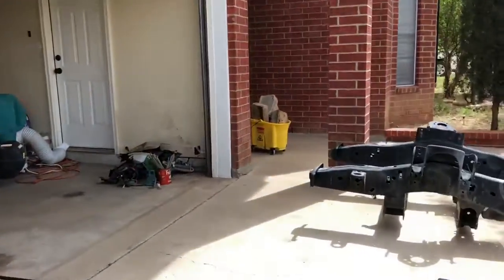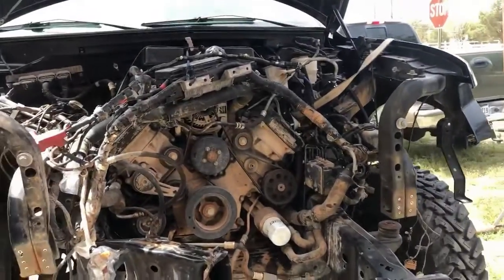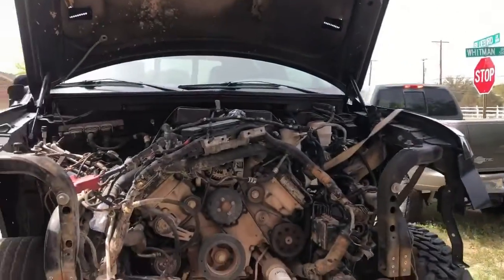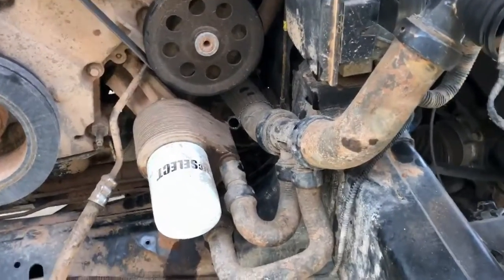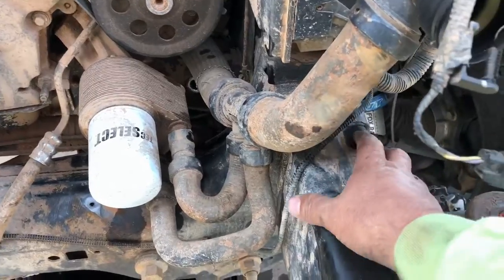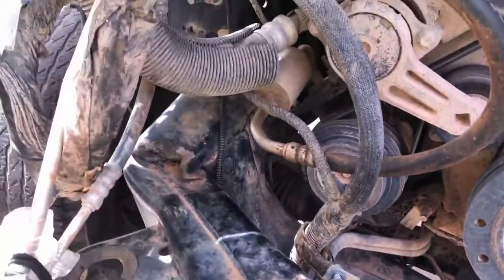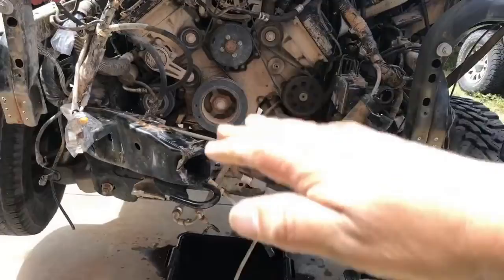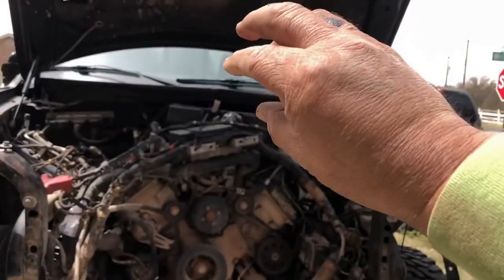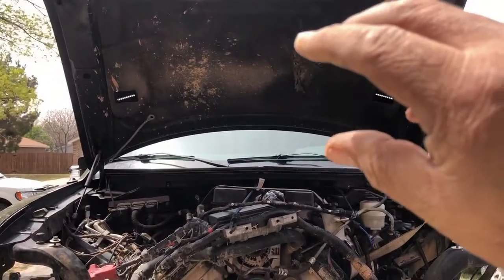Then we're going to put the A-frame over the top of the truck and stick the engine hoist in. We'll lift the frame by wrapping a chain around this frame column — this one's all boogered up, which is actually why I want to do it there. I'll lift the whole frame up high, then strap the engine and suspend it on top of the A-frame, and let it down.